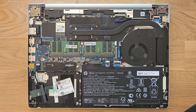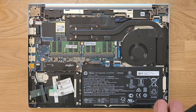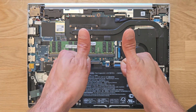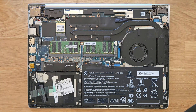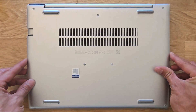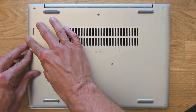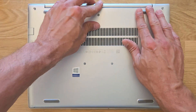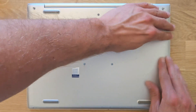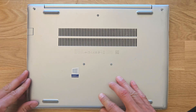One little piece of advice: once you have all the upgrading done and the laptop closed, the first boot is going to take about a minute for the laptop to initialize all the new parts. Don't panic — there's going to be a black screen for a minute or so. It will warn you that the memory size has changed. All you have to do is press Enter. It's a one-time notification only — the next boot there'll be no notification and you're good to go.